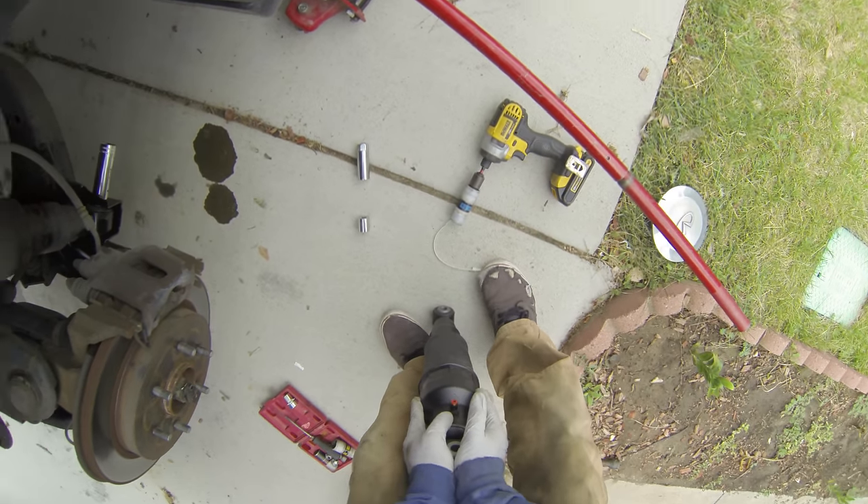That's a 19 millimeter — that seemed to fit the best, standard fits pretty good too. It's definitely super tight so you don't want to break it — that would be really bad. You're gonna have to use a lot of leverage with this long breaker bar. The bottom one is a real sketchy one — I might break it. Let's see if the top will budge — might need some heat. The top one is actually nice and loose. After you get the top off, you can wiggle it around and it'll be a little easier.